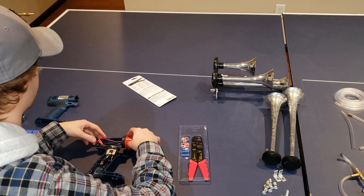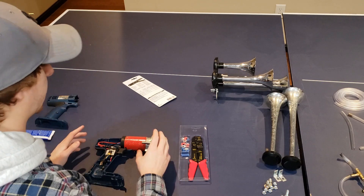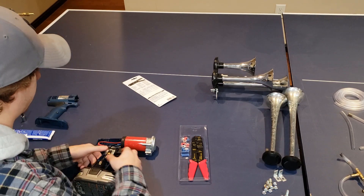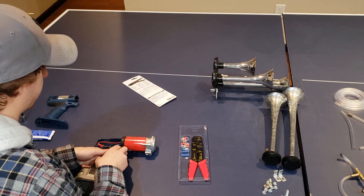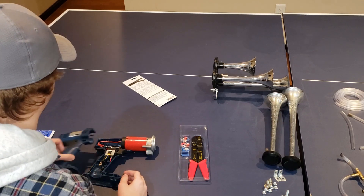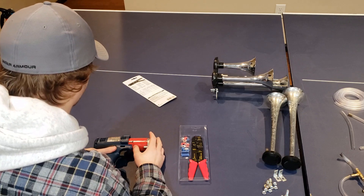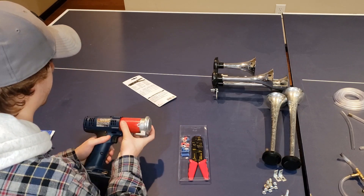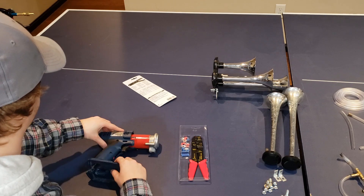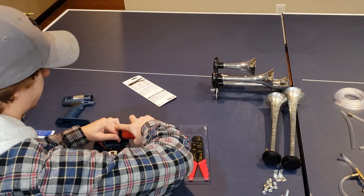I found mine sits pretty well like this. You then tuck your wires down in. Now that you have everything hooked up, you take a battery, hook it up to your terminals, and make sure the compressor kicks on — it does. So from here, we're ready to close everything up. Make sure your compressor is buttoned down pretty well. Then you're actually going to unplug your compressor now that you know it fits and is in good working order.